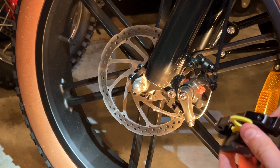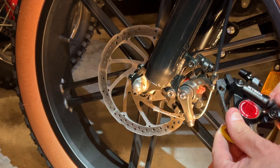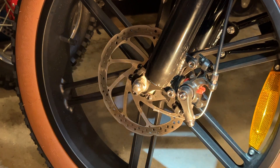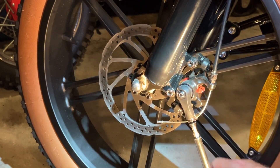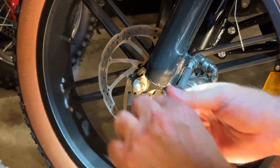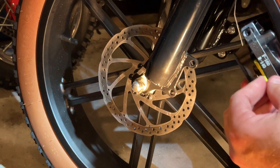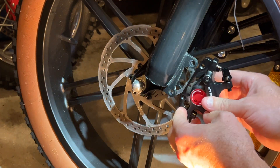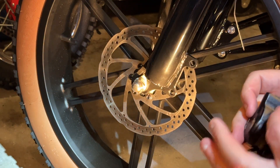Let's move on to the front brake. I'm going to try using the bracket it came with — it has slightly different standoffs for this bike, just to give a demonstration. I'm going to remove the whole caliper with the mount. Use the 5mm to release the cable, add the new brake, pull the clip, and slide this on.